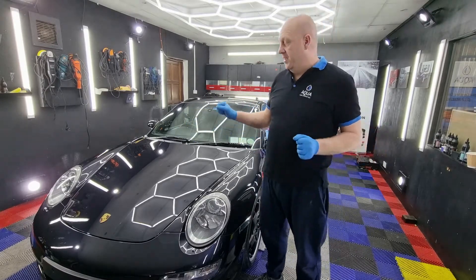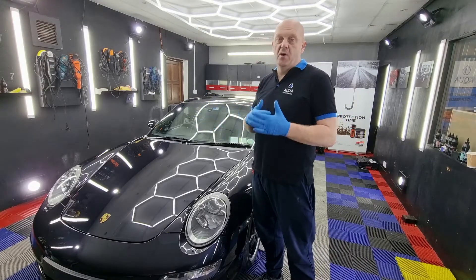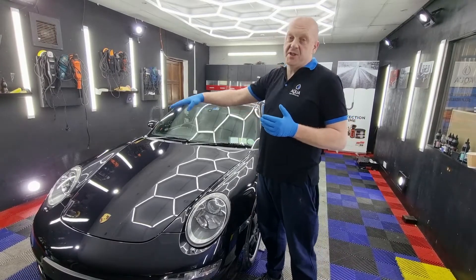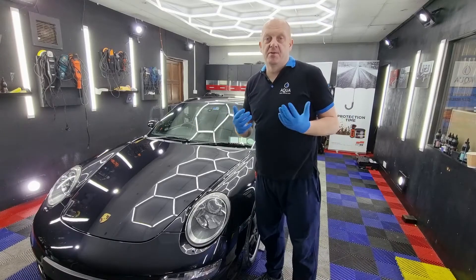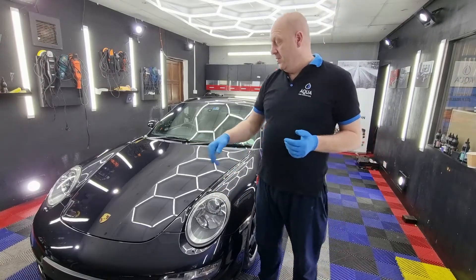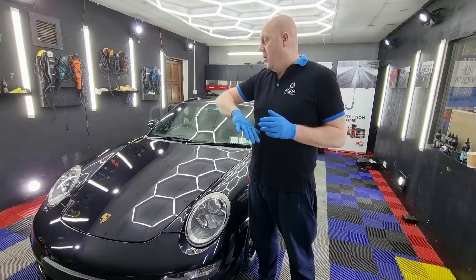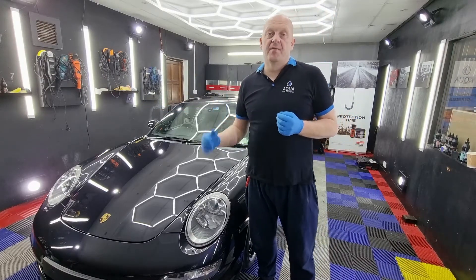In this case I'm going to apply the coating on whole sections because the sections aren't overly big, so we can work with quite a lot of comfort. When it comes to bigger panels like a very large bonnet or roof, we might divide the section into two or four depending on the size of the panel. We can also apply the coating on headlights, fog lights, rear lights, and badges — there's no problem applying coating on those surfaces. The benefit is that the whole surface is evenly covered for hydrophobic properties and protection of those parts.